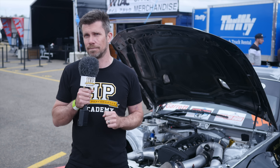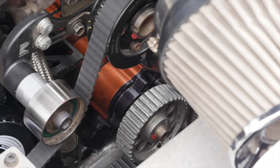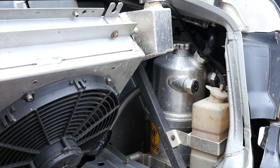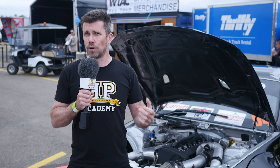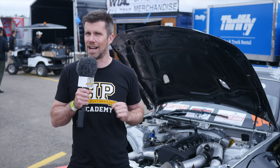One of the common reasons for failure with any Nissan RB engine, particularly in a circuit application, is the oiling system. The factory wet sump system just isn't up to task, with numerous problems with oil surge and reliability of the factory oil pump. Jake and the Powertune team completely eliminated the factory oiling system, going for a dry sump system from the start. That dry sump relies on an external oil pump driven directly from the crankshaft, which scavenges oil out of the engine and returns it to a remote oil reservoir mounted in the boot. A constant supply of oil is then drawn forward by the pressure stage of the pump and forced through the engine, ensuring that regardless of acceleration, braking, or lateral g-forces, the engine always receives a reliable high-pressure stream of oil with no chance of starvation.